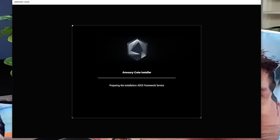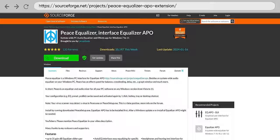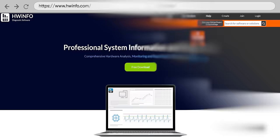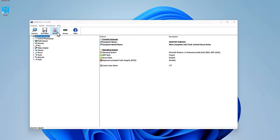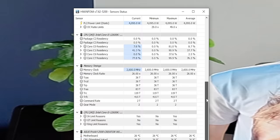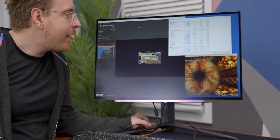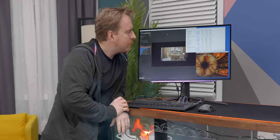The same goes for companion software installed by your hardware drivers — sound control panels, temperature monitors, the list goes on. These are usually not very polished despite the alleged R&D budgets of these companies. So maybe try some third-party software like the Peace Equalizer APO GUI or HWiNFO instead, which can give you much greater granularity and aren't tied to specific hardware. HWiNFO is also a great tool for double-checking that all your devices are showing up and making sure you didn't make any mistakes while installing your cooler. A simple combination stress test like Cinebench and FurMark while monitoring CPU and GPU core temperatures will quickly reveal any critical errors, hopefully before they become a long-term problem. Anything under 90 degrees is probably fine, but 70 to 80 is ideal.